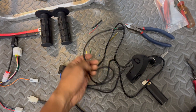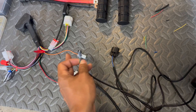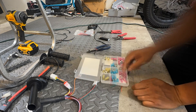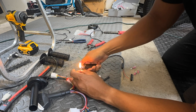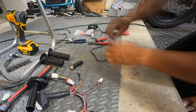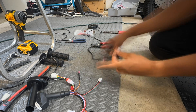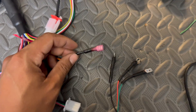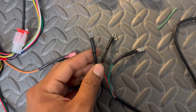Next we're going to do the ignition wiring — cut off about two feet, hook up terminal connectors for the red and black wire, and then extend the green wire to meet up with the orange wire on the Far Driver side. Here's what that ended up looking like: I replaced the connector on the Far Driver side so it's just a single pin that matches the blade connector coming from the signal wire on the ignition, and then hooked up terminal connectors for the power and ground.